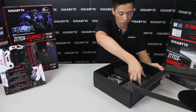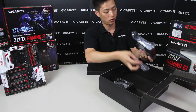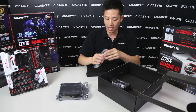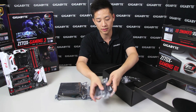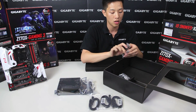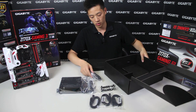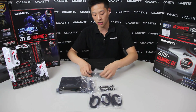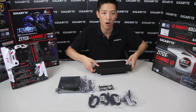Right off the bat you can see you get this premium casing. We have our 3.1 bay — I'm just going to put that to the side. We have a SATA Express connector, three sets of braided SATA cables, and these have your straight-through cables as well as a 90-degree cable. You have a CrossFire as well as SLI bridge, and a Wi-Fi and Bluetooth antenna. This board does come with Wi-Fi like we mentioned — it uses Killer Double Shot Pro X3 and allows you to use multiple LAN configurations.